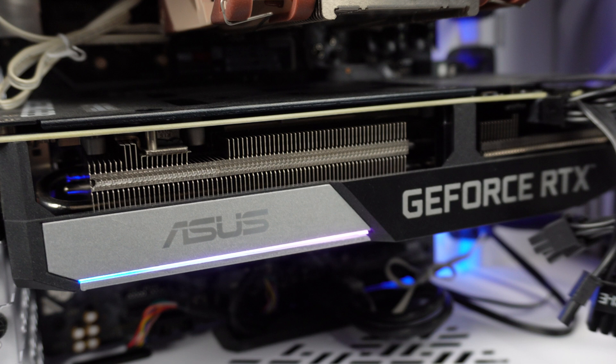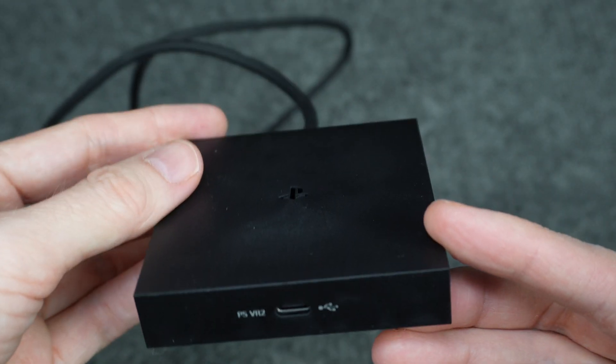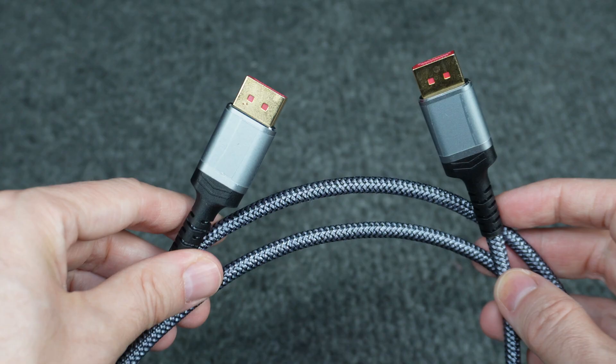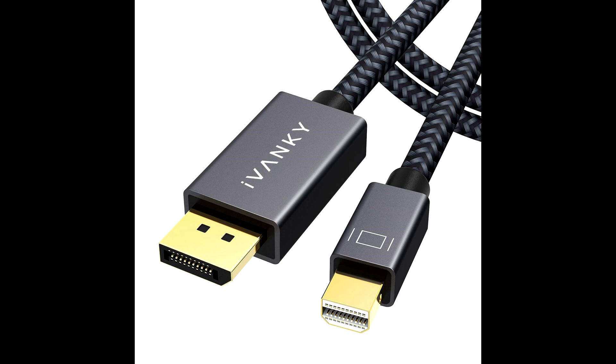The next requirement depends on your PC setup. Look at the back of your graphics card and look for a USB Type-C port — it's a tiny little port. If you don't have one there, you will require additional things for your PSVR 2 to work: one is a PlayStation VR 2 adapter, another is a DisplayPort cord, and you will need a PC that actually has a DisplayPort port. According to Reddit, a mini DisplayPort port will work as well — you'd just need a DisplayPort cord with a regular connector on one end and a mini connector on the other.